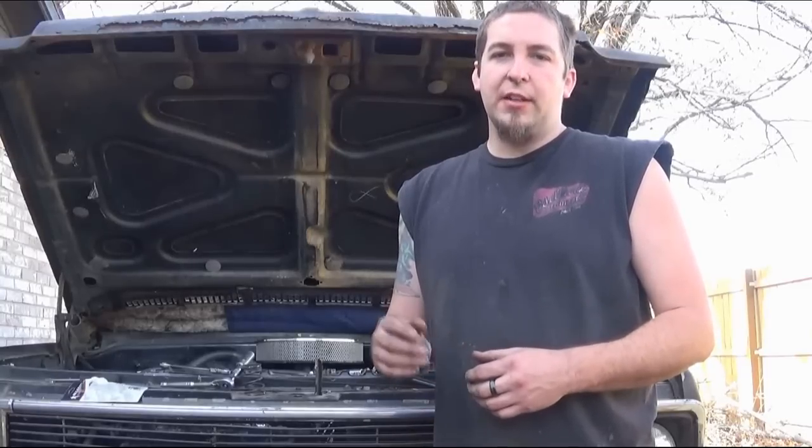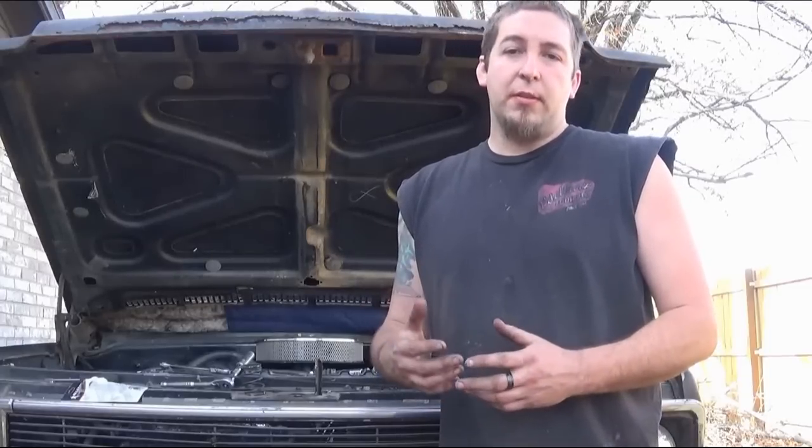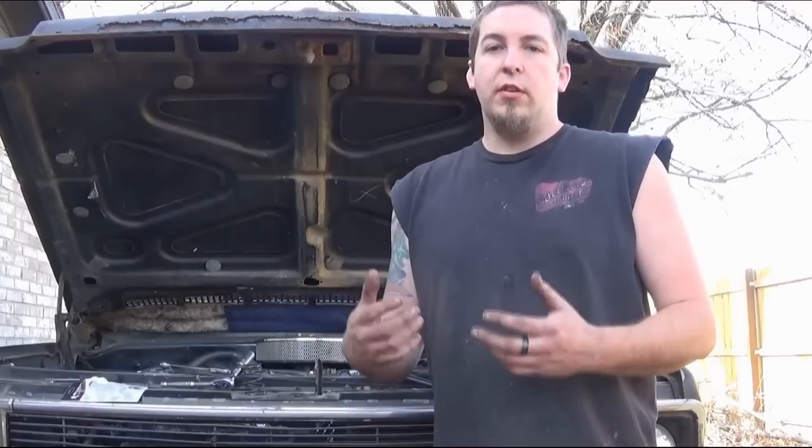The reason we're doing this is because when we got the truck originally there was a bad spot on the flex plate — every time it got to that spot it would grind. It's gotten a little bit worse. Whenever you change a flex plate or flywheel you really need to either change your starter or have the teeth replaced on it, otherwise any damage on the starter will transfer over to the new flex plate and you'll just have to replace things again.